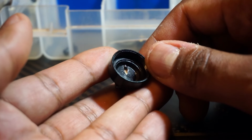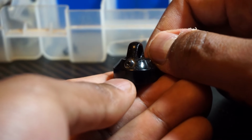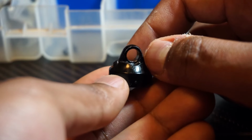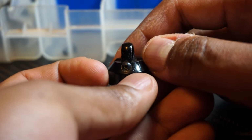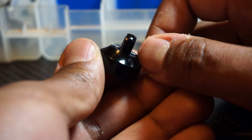Bladder shock caps, on the other hand, use a rubber diaphragm to separate the oil from the air to keep the shock movement as consistent as possible. Most of the time you'll see bladder shocks on cars that need the consistent shock movement on long nitro mains or on smoother tracks with a lot of traction. The only real downside to bladder shocks is that building a bladder shock consistently is a bit more difficult compared to an emulsion shock. Not by much, but just enough to require a bit more attention.